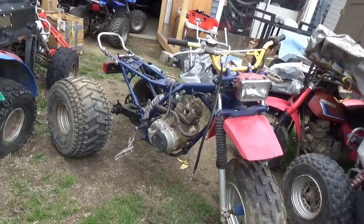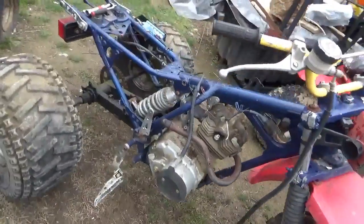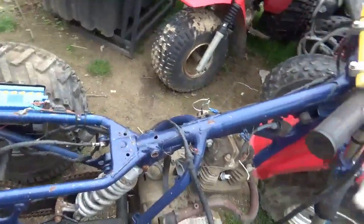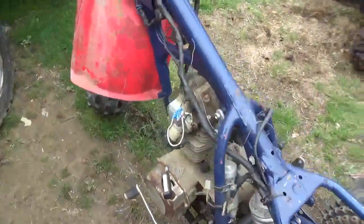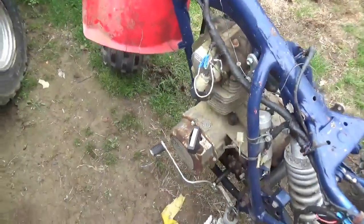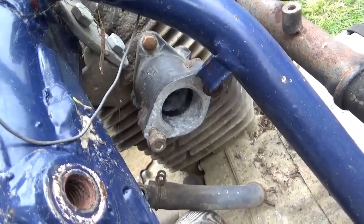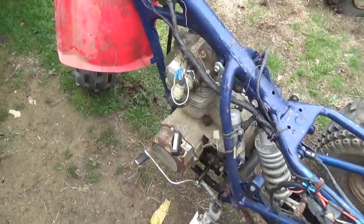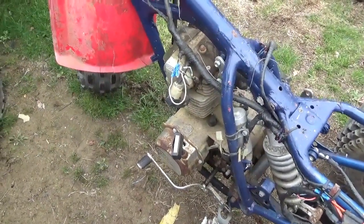What I did is I swapped out the engine. And then I did a very, very bad thing. And let me show you what went wrong here. I managed to get it running. You could see the wires are all fudged around, but from letting it sit, it seized. And then at some point, obviously, I borrowed the carburetor. And from the looks of the oxidation inside the carburetor, water got in. So we're going to try to get this engine freed up and running again.